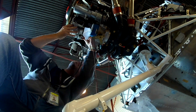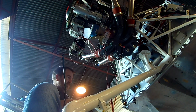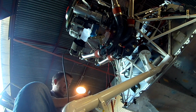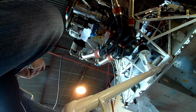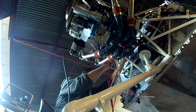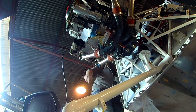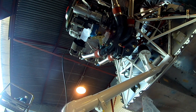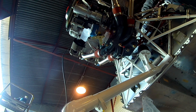There are also going to be two silicone vacuum lines going down the right-hand side, as the throttle body has two vacuum measuring ports. Unlike a normal car with electronic fuel injection that has a mass flow air sensor, this system uses the vacuum ports from the throttle body itself to determine how much air is going through.